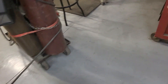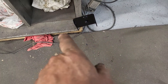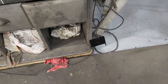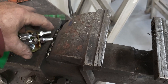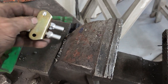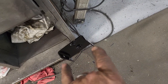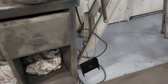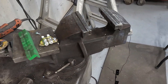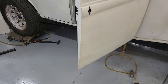Got that mounted, put some seam sealer on it, then hit it with a coat of black. The cable's not attached yet - I had to make a bracket that's going to have to mount to the body because there isn't a good flat area. This is what holds the assembly so you can route the cables up. I fabbed it up and it'll bolt to a crossmember underneath. Letting the paint dry for now.